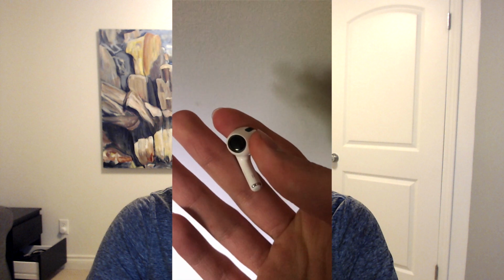First, I noticed that I couldn't recreate the rattle by waving the AirPods in the air next to my ear. Then I taped each individual AirPod to the microphone on my iPhone with each different size of ear tip, small, medium, and large, as well as with no ear tip attached. I could recreate the rattle with all the ear tips attached, but I could not recreate the rattle without the ear tip attached. This means that there was no rattle inside the actual AirPods Pro.